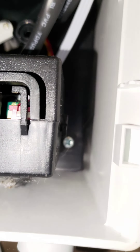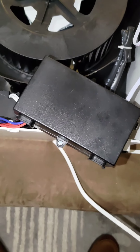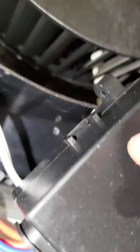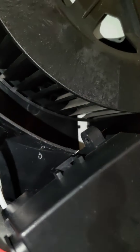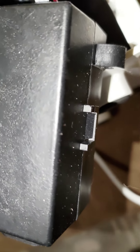The next step is going to be: see that little Phillips screw right there, and that Phillips screw right there — go and take those out. Then once you get those out, there's one more screw. Then there are clips on three sides — you're literally going to pull up and they'll pop out. Get all three of those and then the top of the unit will come right off.